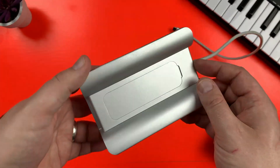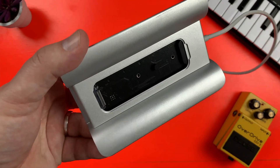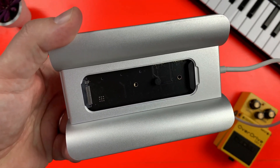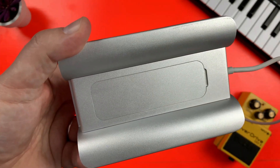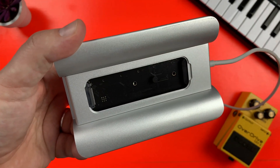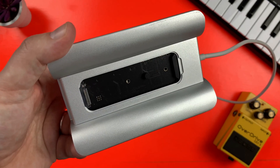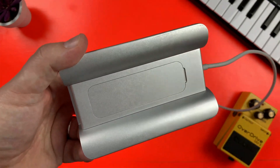Hidden away on the bottom of the dock is a sneaky little compartment where you can install an SSD drive. This dock supports both M.2 NVMe and SATA SSDs, and it's a fantastic way to expand the storage of the Mac Mini. The ability to install an NVMe SSD is especially welcome, as these drives often come close to being as fast as Apple's own built-in storage, and your Mac will see this drive as long as it's attached — a much more wallet-friendly way of increasing your storage.